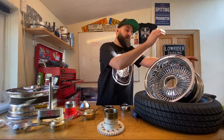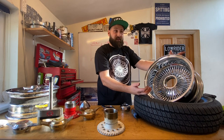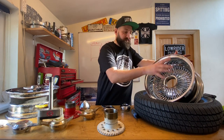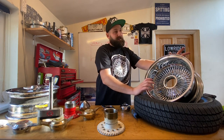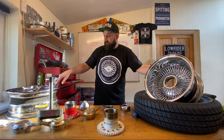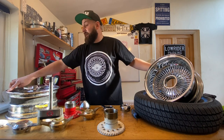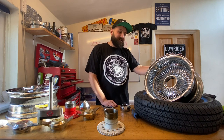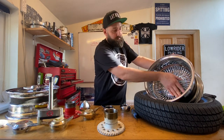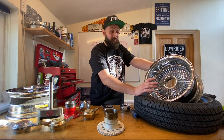There are multiple different manufacturers. Most of the wheels are Chinese-made and relatively cheap — a lot cheaper if you can buy them in the States. They will rust in UK weather. If you put a set of cheap Chinese wire wheels on a UK car and drive them throughout the winter, by the end of the winter the road salt and moisture will obliterate them. There are more expensive USA-made sets with triple chrome plate and stainless steel spokes. Dayton's are probably the most well known — you can still buy them from the States, handmade to your specifications, but they will cost you thousands.